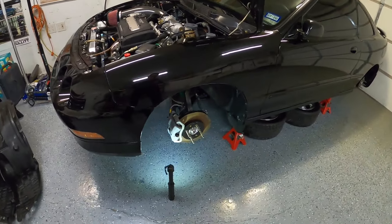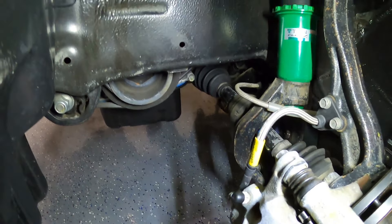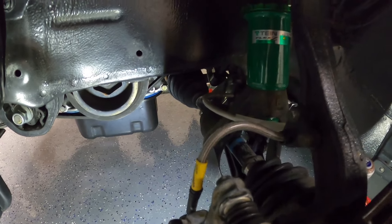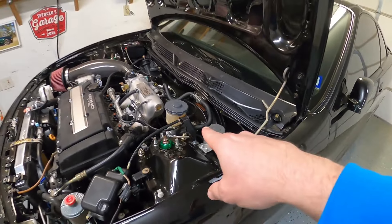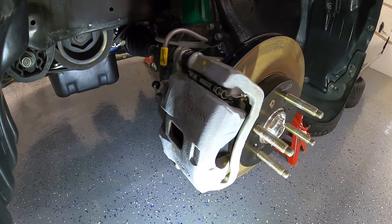The first step is to take off the caliper — about four bolts to undo — but I'm also going to undo the brake lines. I do have some stainless steel braided brake lines in there. When I take those off, my brake reservoir is going to lose all its fluid. I'm not into clamping off the brake lines because that can ruin the innards of the brake hoses. I'll just take them off and bleed all four corners, but I'll have nice fresh brake fluid in the end. If you're interested to see the whole process, stay tuned.